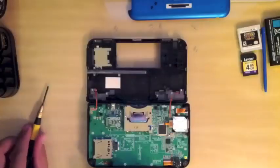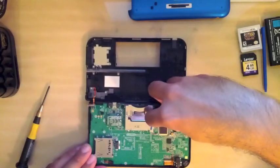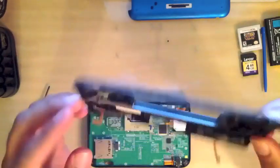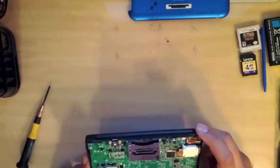Here I'm showing you the right-side ribbon cable and the left-side ribbon cable. Using your fingernail, go ahead and pry the ribbon cable clips off from the motherboard, then set the bottom cover off to the side and take a look at our working space.